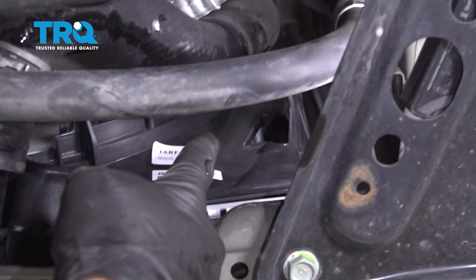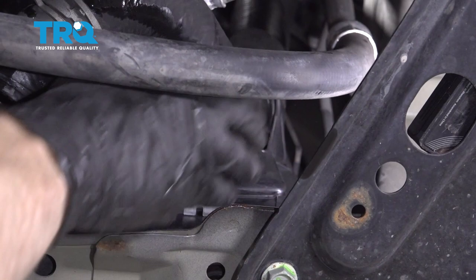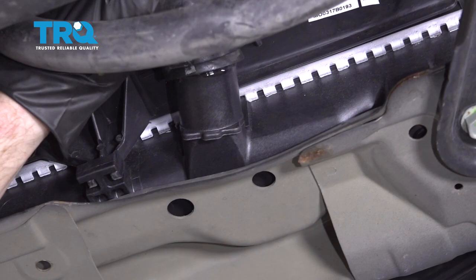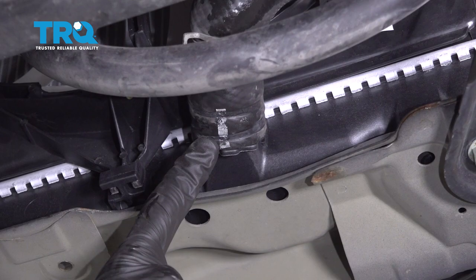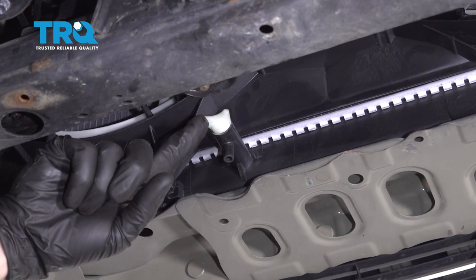Next, let's move along to our lower radiator hose. Up along the passenger side of the cooling fan assembly, you're going to have that little hook that the hose needs to fit into — go ahead and put it right in there. Now we can connect the lower radiator hose to the radiator. Slide it in until it bottoms out and then replace your clamp exactly where you removed it from. Continue on to making sure that your petcock is nice and tight.